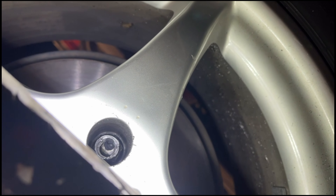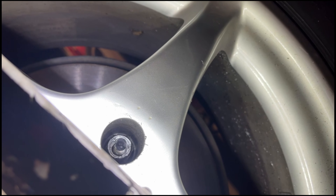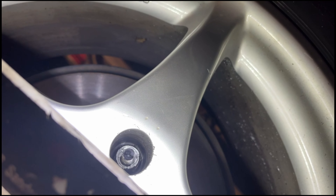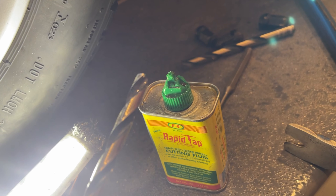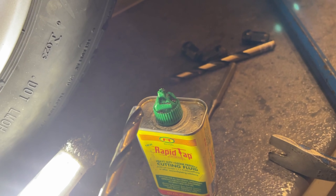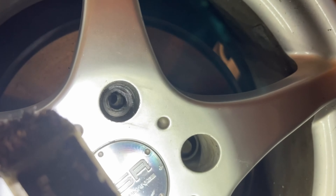There's the progress — drilling slowly through so it doesn't rotate, which is why I'm off to the side. It's also going to split the nut, but I think I need a few more drill bits to upsize. A quick note: always use some type of cutting oil, because a dry bit creates so much friction it'll ruin your bit.